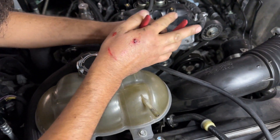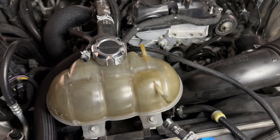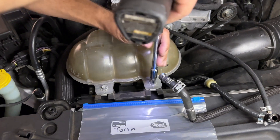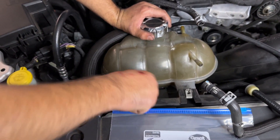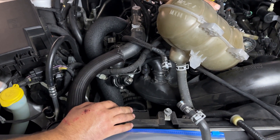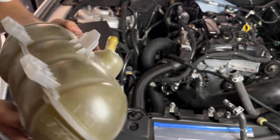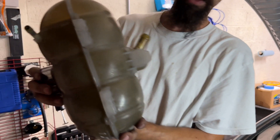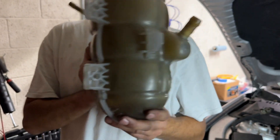The more stained they are, be careful with them because they are very fragile. You do have one more hose on the bottom. Take this long extension here, and put the bolts back into the fan since the fan is not going anywhere — it's a good place to keep them so you don't lose them. As you can tell, you still have coolant in here — and as we said about coolant, you're going to make a mess. Drain it all to one side so you don't lose any of it. Mine is pretty dirty, so it would be a good time to clean these things. There are plenty of videos out there showing you how to clean them.